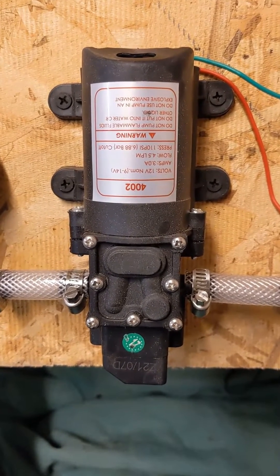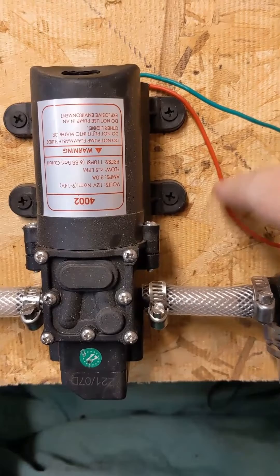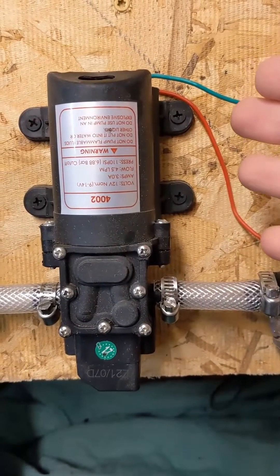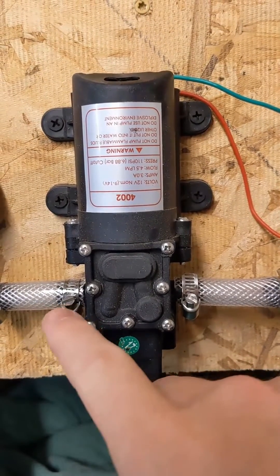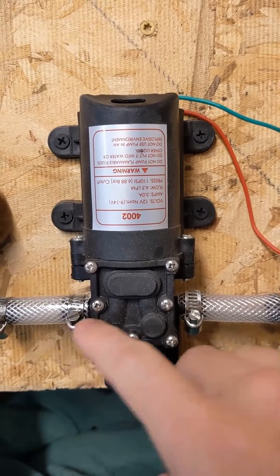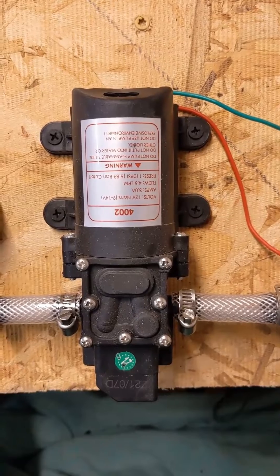I made a replica of the water system that I have in my van. Here's the pump I used — I just bought it off Amazon, I'll include a link in the description. It runs off 12 volts, so you wire 12 volts here, this goes to ground, this is the water line coming in, and this is the water line going out. You can have voltage to it at all times. This senses when you open your faucet or spigot — there's a pressure sensor in here that's monitoring the pressure continuously of this line, and if it drops, it will turn on. There's a screw in the pump head that you can adjust where that pressure trigger happens.